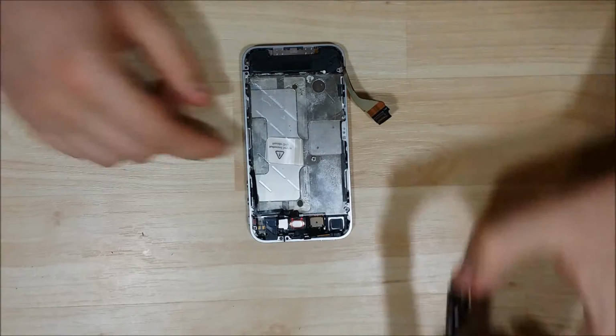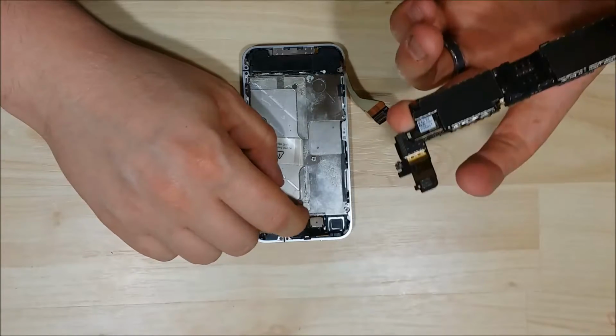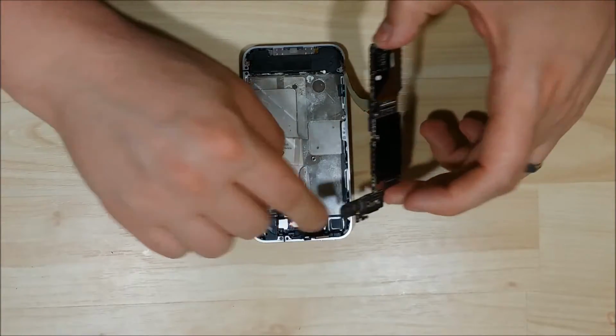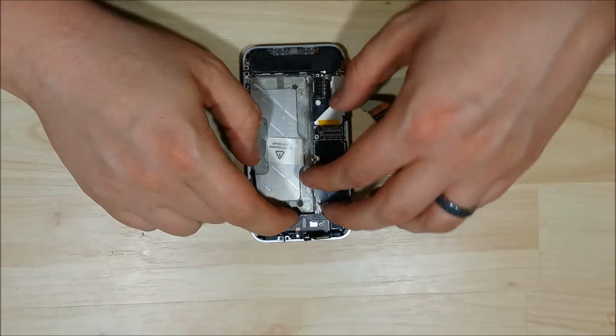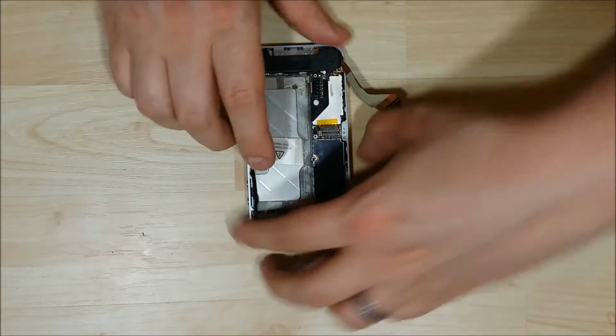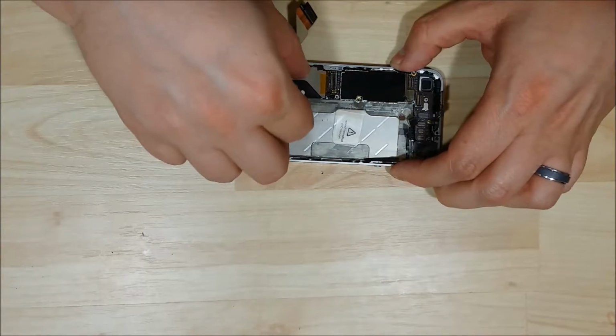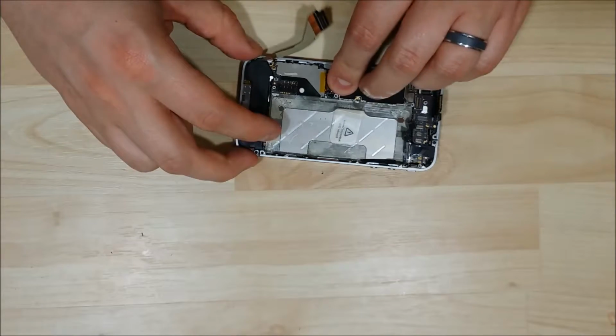The next thing we're going to do is go ahead and put in our logic board. It is a little bit tricky to make sure it gets a nice and tight fit. There's the 3 ribbon cables on the right. Above the battery is the 2 upper LCD cables. You want to watch the lower cable and the antenna cable that comes with your bottom speaker portion. You need to make sure all 3 screw holes line up.